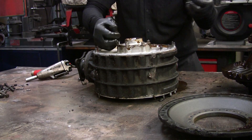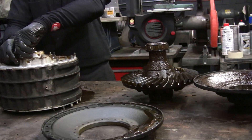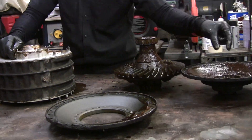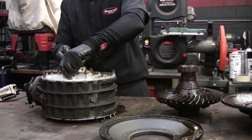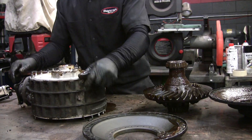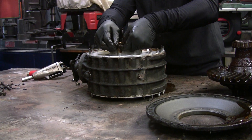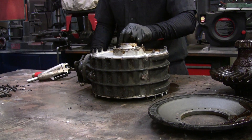The work on these is not that hard if you don't mess with the adjustments — that's where you get in big trouble. The adjustment on this side screws in and out, and what that does is just adjust how much tension there is on this. There are also shims on this side to adjust the position of the big gear in the middle. Differentials are almost an art to set up with a ring gear and pinion. I remember having a hell of a time on an Aston Martin back in the 90s.